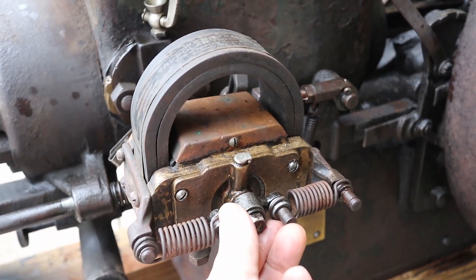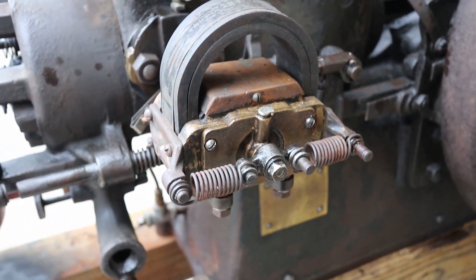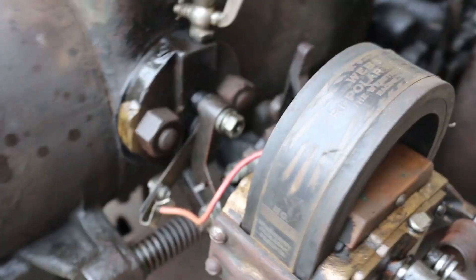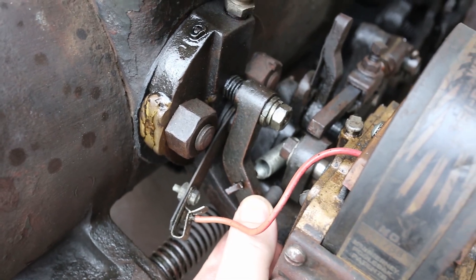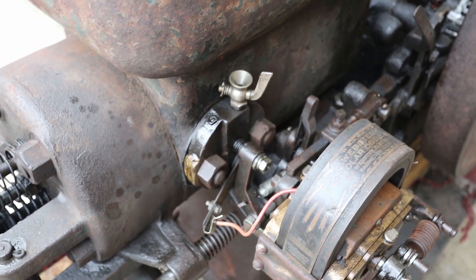On that first click, this part of the magneto rotates — and this is a horseshoe magnet with copper windings inside. So it creates an electromagnetic pulse of electricity, which is transmitted through the wire to the igniter, to the points. This little lever here opens up the point gap just a little bit. The points are closed, and it's timed so that it opens up the point gap right when the spark comes. The spark bridges the gap and makes a little jolt of electricity that's really hot and ignites the fuel.